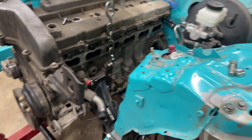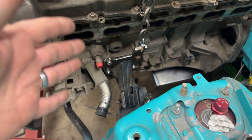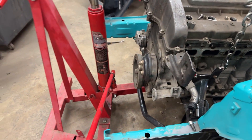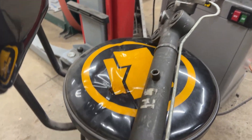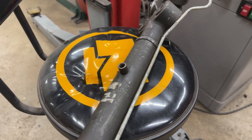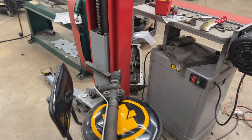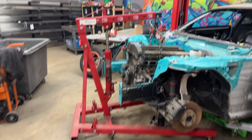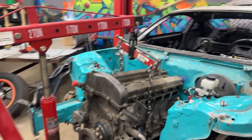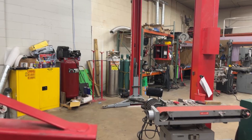We had some small issues with fitting on the chassis. We had to remove the steering rack, which isn't that big a deal. Cam was able to get it back in, but on the steering rack there's a slight problem — there is a center bung for the power steering high pressure line that is dead center on our oil pan. As we lowered the motor down, we noticed it was going to make contact with that bung. We don't have the fittings or lines for it since our shell didn't come with them, so we went out yesterday trying to find a place to custom make some with banjo fittings. No one had what we needed, but we've identified the fittings and have parts on order. We're going to make our own, and probably a few extra sets to sell.